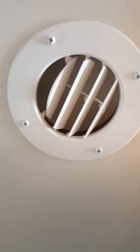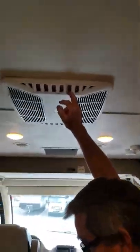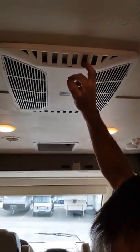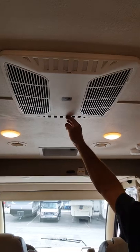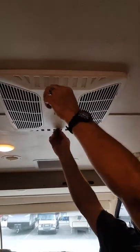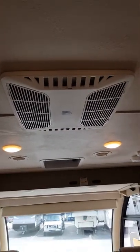When you rotate the vents you might get a little bit of insulation debris out of them — don't worry about it. What you don't want to do is close more than 50 percent of the AC vents. If you close more than 50 percent, the back of the air conditioner will freeze up, stop running, and it'll take four to five hours to thaw out. Closing these vents forces more air out of the ducted vents; opening them cools this room faster.